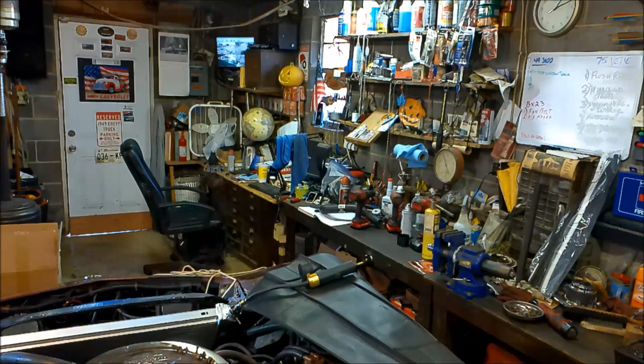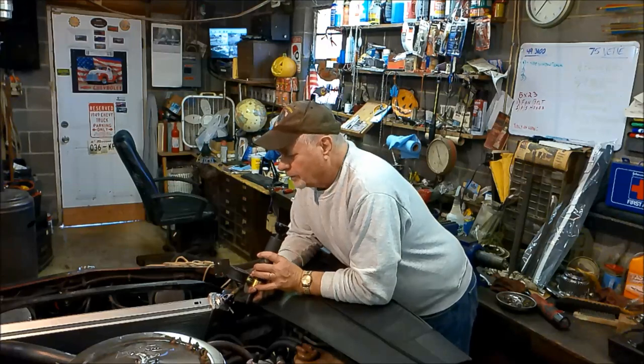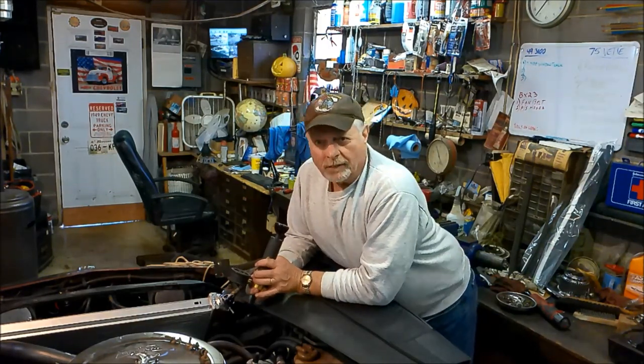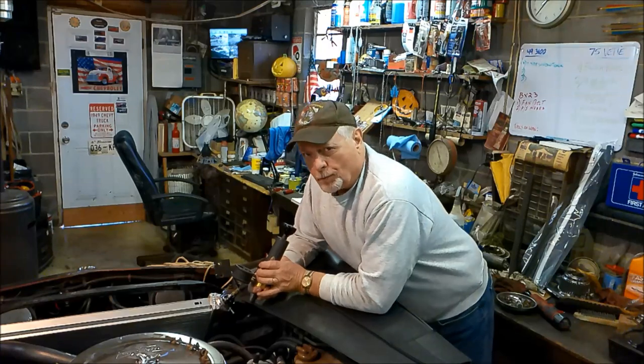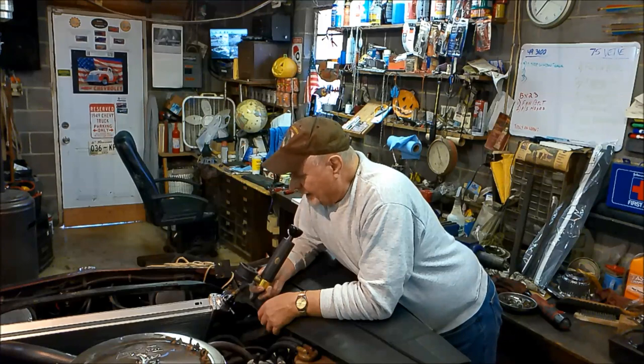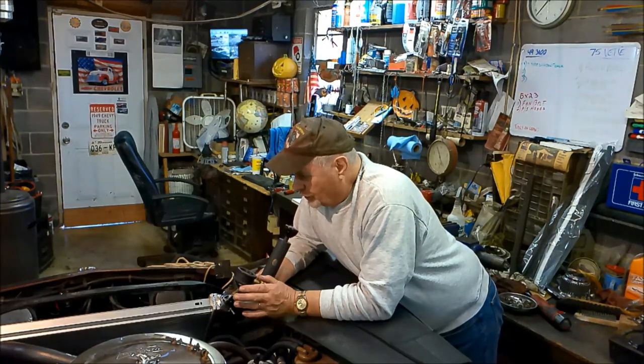We'll come back in about 15 minutes and see if it's still at 5. Well, all right. It's been about a half an hour, and I went out there and cleaned up the shroud and gave it a coat of flat black. It'll be in mere moments to you all, but it's going to be another day before I attempt to put it in. But more importantly, we're still at 5 pounds, a half hour later. So it's holding. All the soap is drained away.